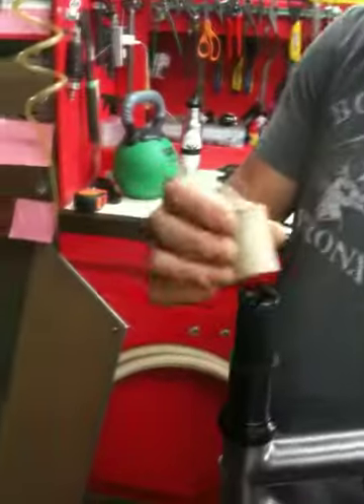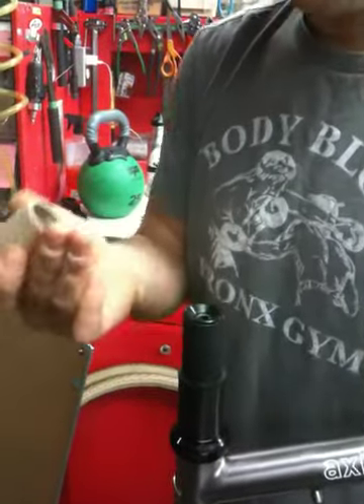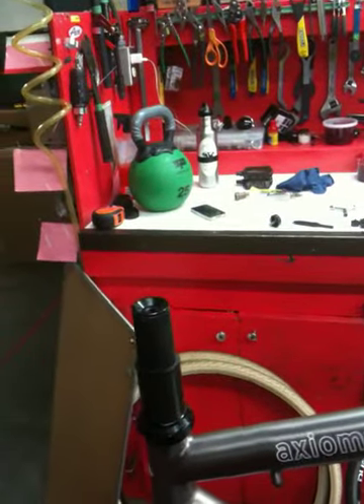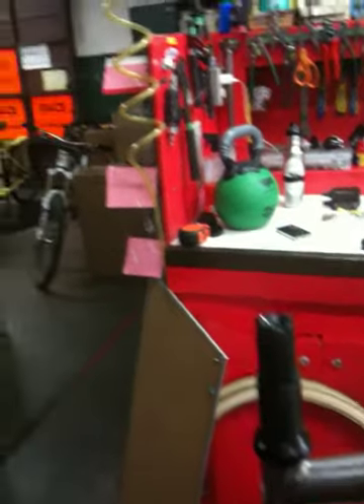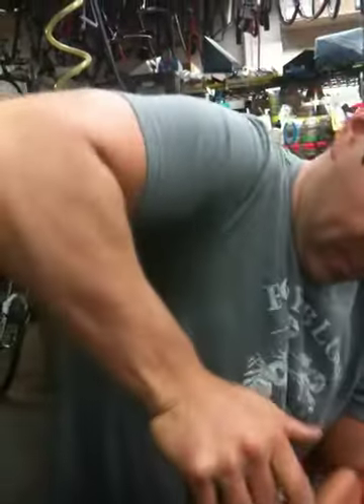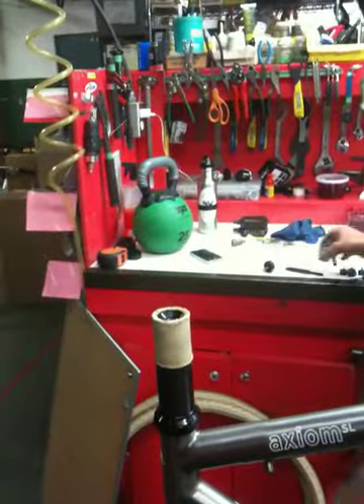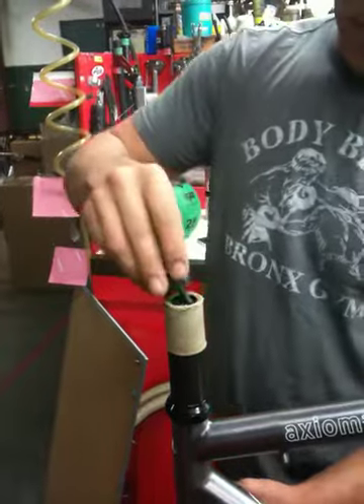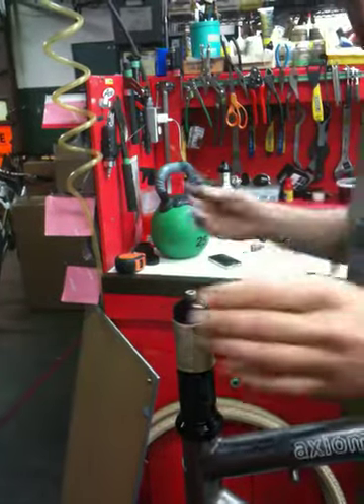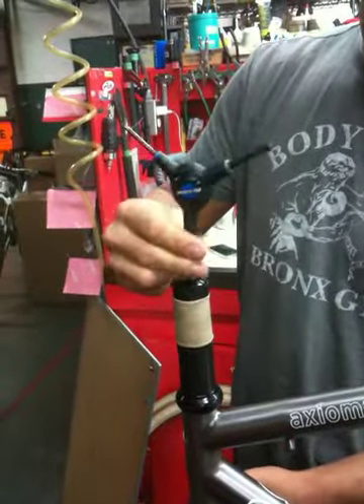What I'm going to do is slide this cardboard block here — actually this one's too small, one moment. That just acts as a spacer since the stem is gone. It keeps the fork from sliding down, and I'm just going to tension it on there just like I had the stem in there so it can travel without banging around and losing any spacers.